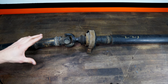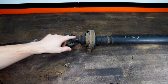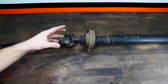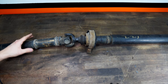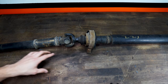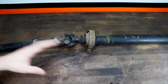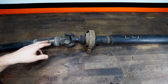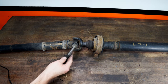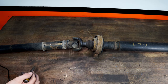The main important thing when dealing with driveshafts is that you've got to put it back exactly the way you took it apart. There are splines in here that connect this axle to this axle, and you want to make sure you get the splines in exactly the same position. On the old 740s, you had a little mark — like an arrow, or a painted yellow dot on each shaft — so you could match them up. But on this driveshaft, I can't find anything like that. So what I like to do is make a little mark on each axle right where we take it apart, so I know exactly how to put it back together again.